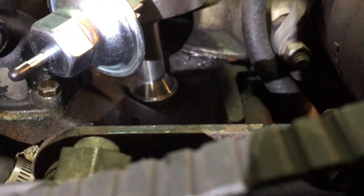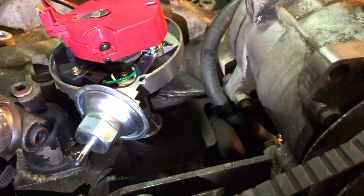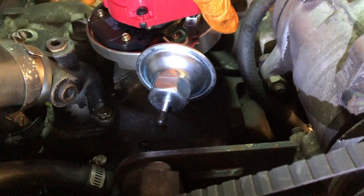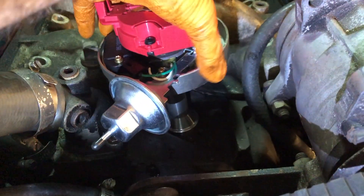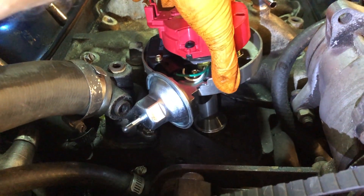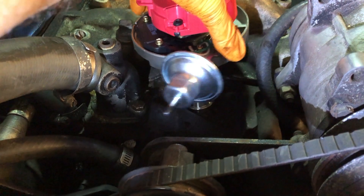Got just enough clearance over here — this side looks good now. And we are all the way at the base, where we're supposed to be. This is that wide HEI unit, and there's plenty of room for adjusting timing and whatnot. Of course this isn't lined up right, but that's for later when I put everything back together properly — set the TDC and all that.